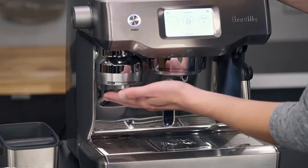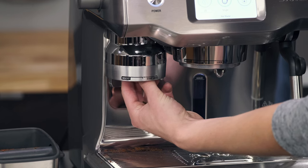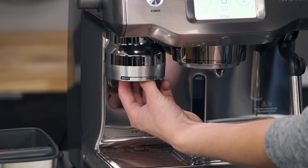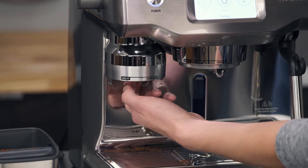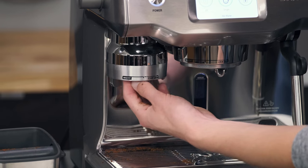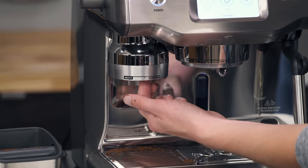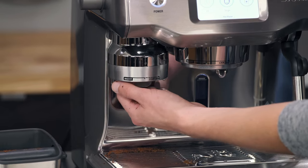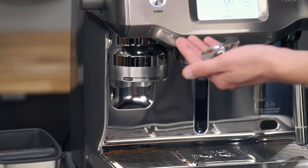Inside of the tamper, you are going to feel two ridges. The easiest way to get at this is you're just going to put your thumb along the edge of this ridge and screw counterclockwise. You're going to feel the tamper fan starting to come out. It takes quite a few turns, about 10 turns or so, to get this to drop out. But eventually it will drop out.